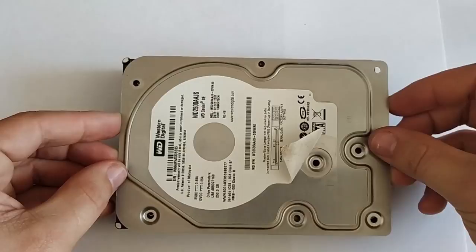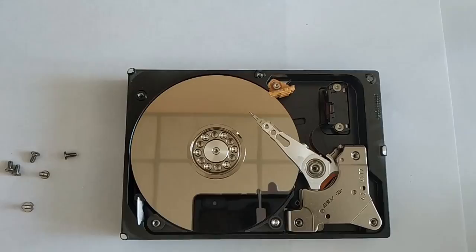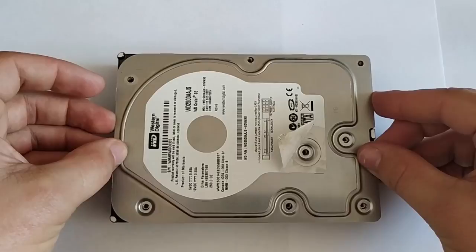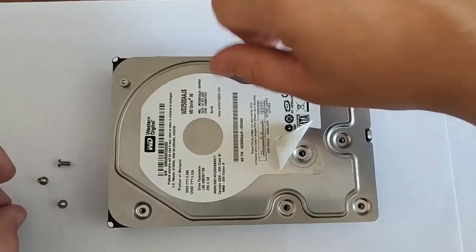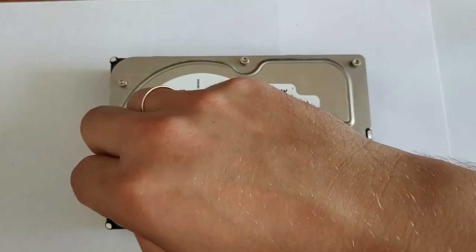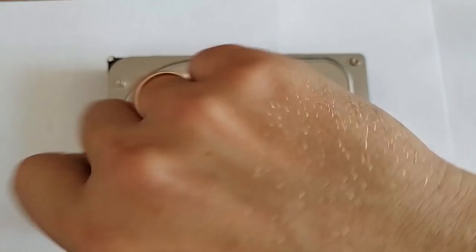If the information on the hard disk is not vitally important and you wouldn't like to pay too much at the service workshop, and if you are sure that the actual problem is the magnetic head getting stuck — which you will only find out after you open the hermetical block — you can take the risk of putting the heads to their proper place on your own. However, if the information is too important, never open the hermetical part without the required skills and equipment. It's almost impossible to do without damaging the head suspension and platter surface, and even in the cleanest room, dust can cause more scratches, making it impossible to restore data even in a specialized lab. So before you begin taking the disk apart, think carefully about all pros and cons of your decision.